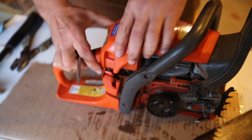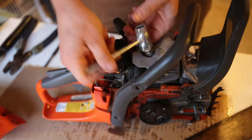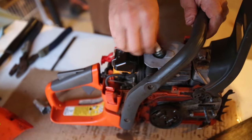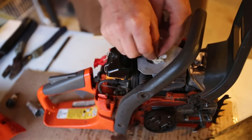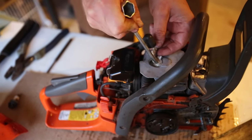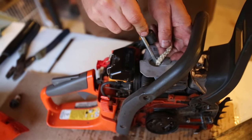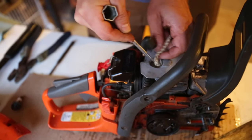This one has three clasps. Remove the cover, and then remove the spark plug. With the spark plug removed, I've got a soft fabric rope and I'm going to slide it into the cylinder cavity. The reason I'm doing this is because it's not going to mar up the inside of the cylinder or the piston head, but it'll allow me to stop the piston as it rises towards the top of the cylinder.